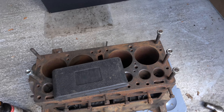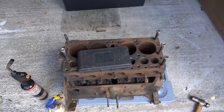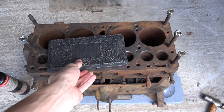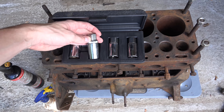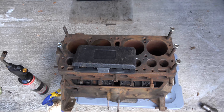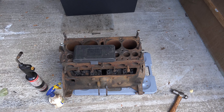So what we're going to do is find your stud and remove it - unscrew it and pull it out. No, of course it's not that easy - sadly the studs have got nothing to grip onto, so you have to find a way of getting them out. One of the ways I've found which works really well is this stud removal tool. These are really nice - they've got a little cam inside them which grabs hold of the studs and they don't seem to destroy them. They just grip them and don't wreck them, as far as I've found so far.